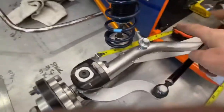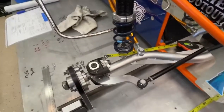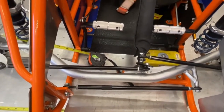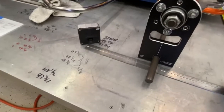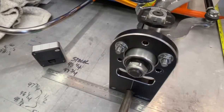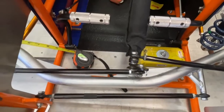We measured the distance from there to this panel. All these dimensions are on Nervo's website, so you can go right there and print out the sheet for your car. The other thing is, if we wanted to move this axle right or left, we would take this bar, loosen the nuts, and move it in or out. With the steering, we like to take these longer bars and measure from this side to this side to get it perfectly dialed in. Then we will loosen these steering rods and make that adjustment on the front steering.